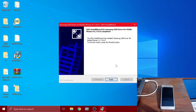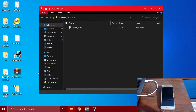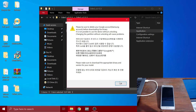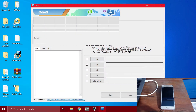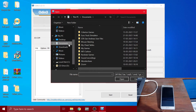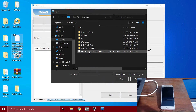After the USB driver is installed, you can click finish. Now you need to open Odin — it's the blue color thingy right here — just click OK. Now you want to select AP. After you select AP, you need to browse to the downloaded original stock ROM. Mine is on the desktop right over here, so I'm going to choose that. While that is loading, we'll get the phone ready.